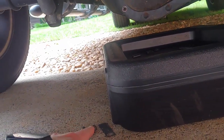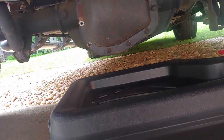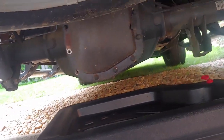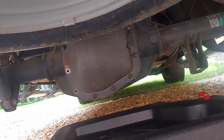These bolts in the differential are a 1/2 inch bolt. They're not metric. So you also want to have a big catch basin, because it starts to make a mess. There's no plug in this other than a side plug up top, and a regular ratchet fits that, a ratchet head, not a ratchet socket. And you want to open that up before you get started, by simply going counterclockwise.